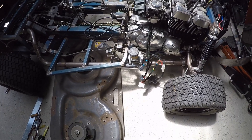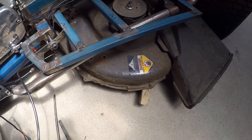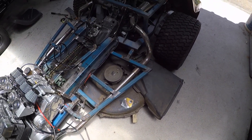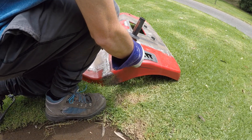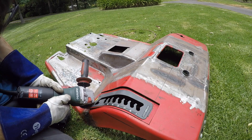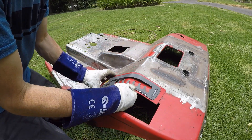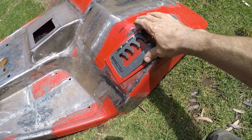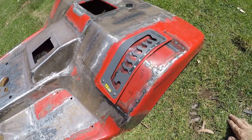The next challenge is really the cutter — there's not much room left. I've got to figure out how to put the linkage in, how this thing's going to go up and down, and how I'm going to drive it. If you notice, it's 180 degrees different to how it came out in the normal mower, but that's how I want it. This cut is to get the height to go up and down — it was a little bit too far out since I modified the width of the bodywork, so I've welded a hole up there and moved it in about 80mm, which I think is a much better spot.